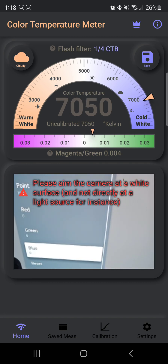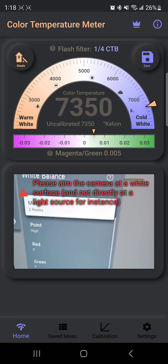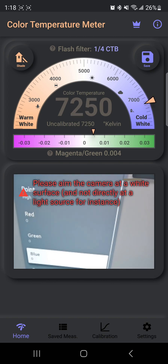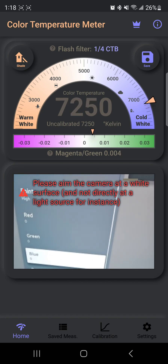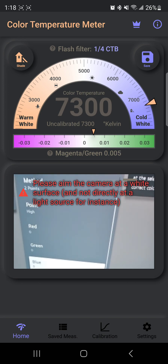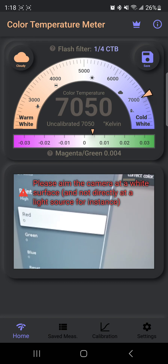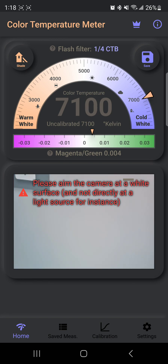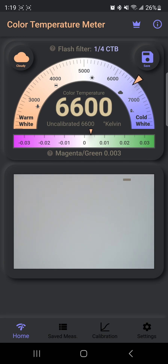The picture quality looks incredible after I made these changes. We're going to select the two-point method of calibration and I'm going to start by lowering the blue until I get 6500K. My recommendation on this WRGB OLED is: do not touch the red — just leave it alone, because the red is clipping before the rest of the colors on HDR especially. So we're going to lower the blue.